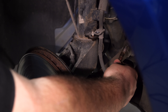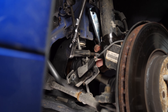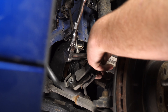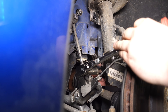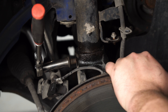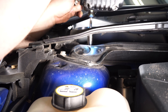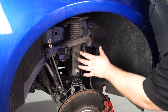Remove the bolt but don't set it aside just yet. We're going to install it on the back side of the steering knuckle and re-thread it in, because there's a slit right there. We need to put a piece of steel — or anything really — in that slit. When we tighten this bolt, it'll hit the piece of metal and spread the knuckle, releasing the strut. It's compressing the piece of steel. Once you feel it get tight, just give it a couple rotations and it'll spread it, releasing the strut. You'll know you've threaded the bolt in enough when you can wiggle the steering knuckle and see it moves independently from the strut. Remove the three bolts from up top that you loosened earlier. The strut can now be completely removed.